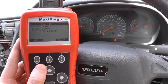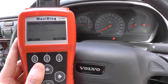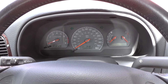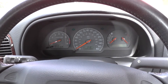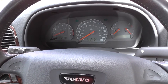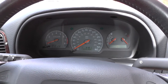Once we've done that we'll come back and we should be able to erase the trouble codes and remove the airbag light from the dashboard. So we'll come back very soon. Alright, we're back in the vehicle now. Having looked under the passenger side seat, we did manage to find what looked to be a faulty and loose connection. There was also a bit of shard plastic on the floor — we're not exactly sure how that happened — but we have managed to put the connection back together.